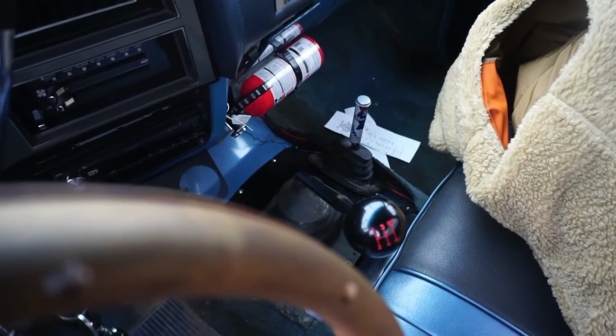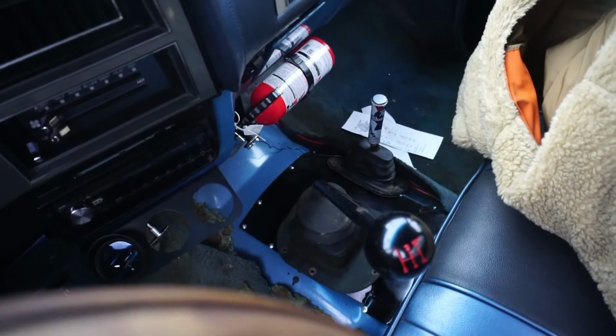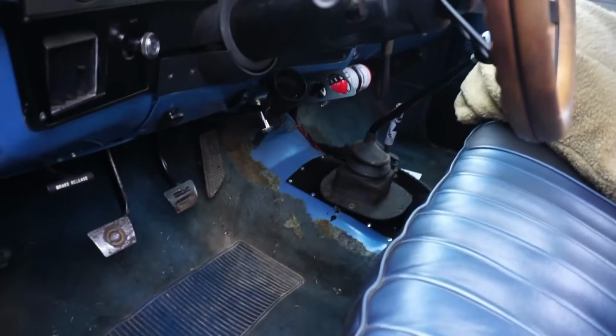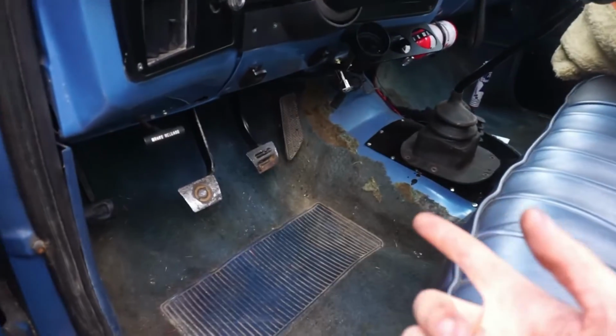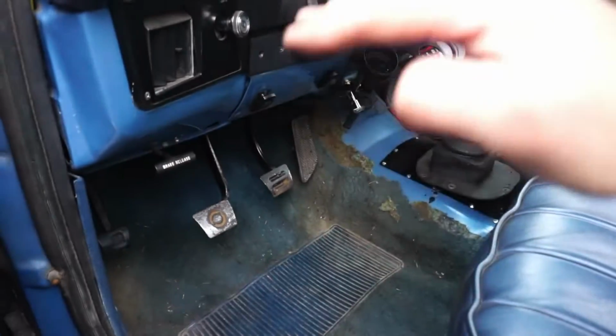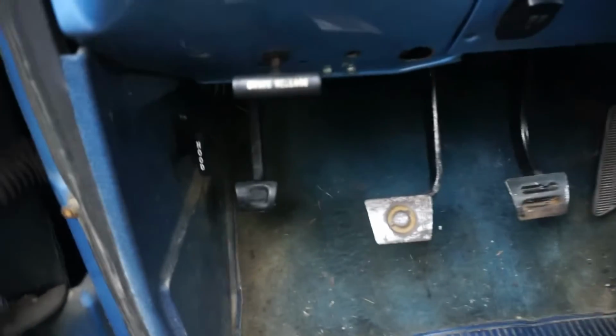This truck has a body lift in it, so you don't have to cut too much to clear that NV45. But if you don't want to run a body lift and you're running an NV45, you're either going to have to put the body lift in, or you're going to have to cut more of that trans tunnel and rebuild it up.